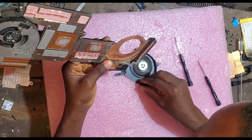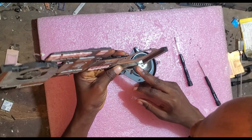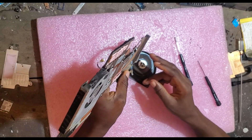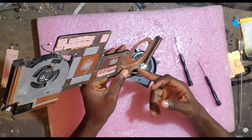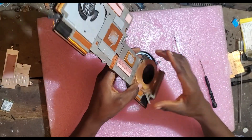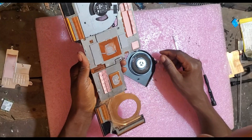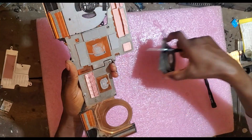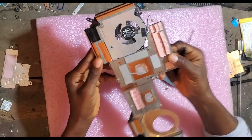There's quite a bit of dust — look at that. A little dust actually makes a big difference, because it serves as a kind of insulation so the fan will not effectively cool the component. The dust has covered the surface, so the air will not be effectively blown across the heatsink, and therefore it won't cool the CPU or GPU properly.